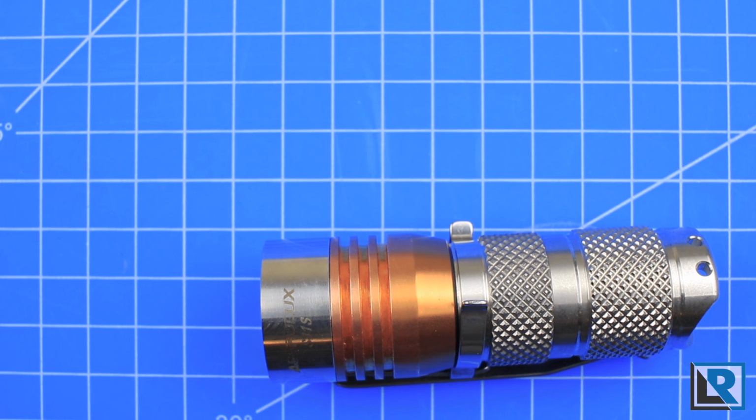I then picked it up with my sleeve and took the battery out because I knew it wasn't good for the battery itself. I went and got a non-contact thermometer, and I measured it at 165 degrees, and the light itself, after it had cooled down, at about 155 degrees. This is dangerously hot, not only for humans and burns, but it's also pretty dang hot for the battery.